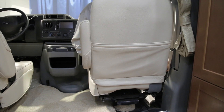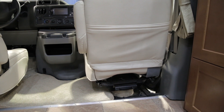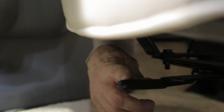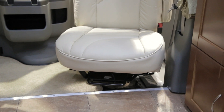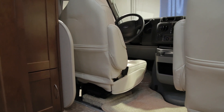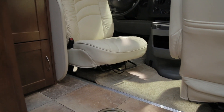Your vehicle is equipped with swiveling passenger and driver seats. To swivel your passenger seat, place the seat in the center position on the slide track, move the backrest into the full upright position, and release using the handle on the side of the swivel base — swivel the seat with the backrest towards the outside of the vehicle. Once swiveled, adjust your backrest to the desired lean and slide the seat back into a comfortable position. The driver seat will also swivel — slide it to the central location on the slide track and find the release on the driver-side door side of the seat. This seat will only swivel 90 degrees or a little more because of the steering wheel position.